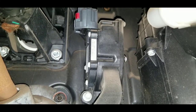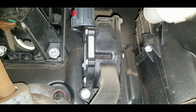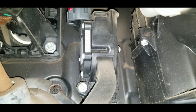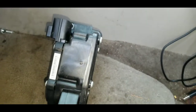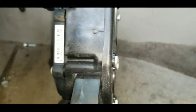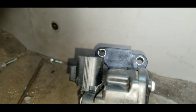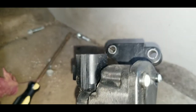I'm going to take a flat blade screwdriver, go up in there and catch the edge of that connector lock and lift it up a little. Then I'm going to use it to depress the button on the side and lift up on the lock while I'm doing that. Sadly, I won't be able to film it because my hands will be busy. Here's the old one — you can see it's all dusty. That's the one we just took out. It took me less than five minutes to get this out with my nut driver and my short extension.